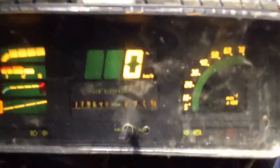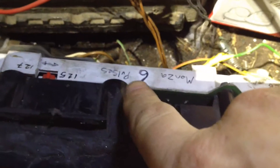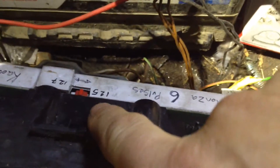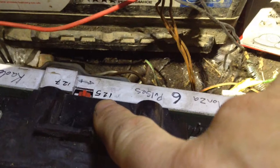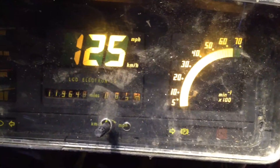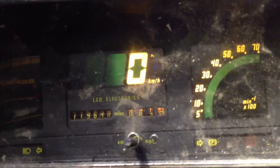Great. Now we turn off the dash again and flick it to the right. This is now in the Monza position, which is six pulses, so it should read 125 when we turn on the dash. And there's 125 — all right, now we test it.